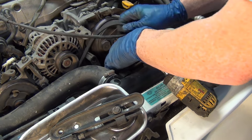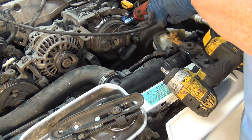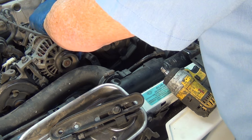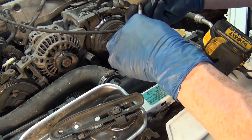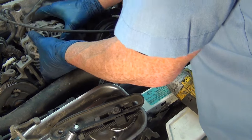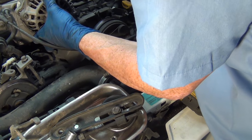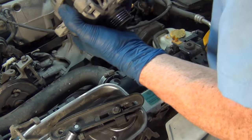We can take the belt off — there's no tension on it. We're going to pop our lines off. You want to grab the little flag or tab for the alternator bracket on the back side; if you fail to do that, it's going to fall back in there. I'm going to clear this completely so I don't ding up my intercooler. It's tempting to set things on the intercooler — I don't mind setting a belt on it, but an alternator on it is crossing the line.